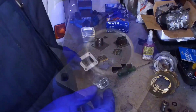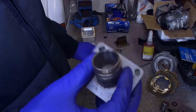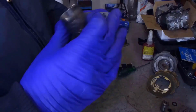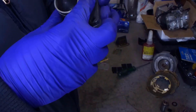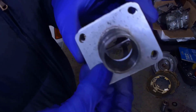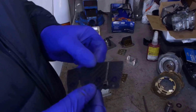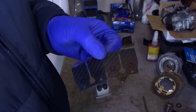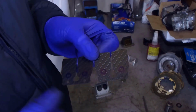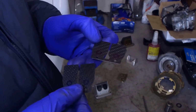Another thing I want to show you is the perfect elaboration between the collector and the flow guide. In fact, by mounting it, we can see there are no bumps. Since the carbon plate from which we made the reeds was slightly curved, I proceeded to identify the exterior by drawing these circles with a marker. This way the closure on the engine side will always be ensured by the carbon foil's curve.